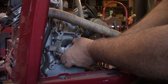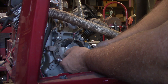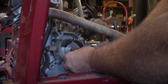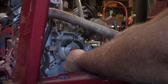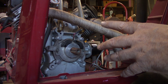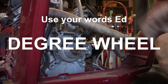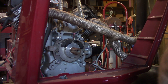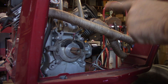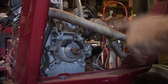Now to set this up — there's the magnet right there, and Kohler does this really cool thing where the number one cylinder is lined up with your keyway. We're gonna get that back on there, and you don't want it touching the plate, you want it out just a hair. I'll turn the motor over and snug it up because we're gonna have to adjust it. Once we get the coils on I'll get my timing light put on there and we'll get this thing dialed in — I want to set it right around 36 degrees before top dead center. I'm gonna get the camera moved over, get the coils put on, get the wires ran and secured, and then we'll come back and time this thing.